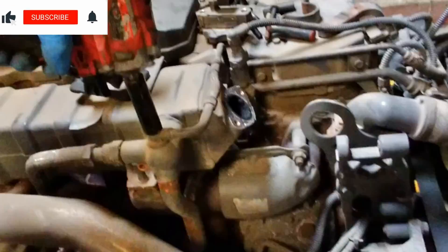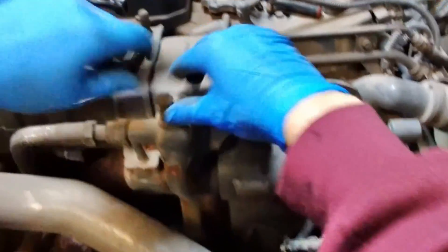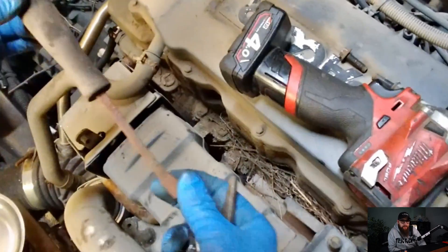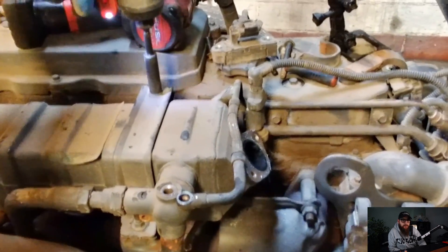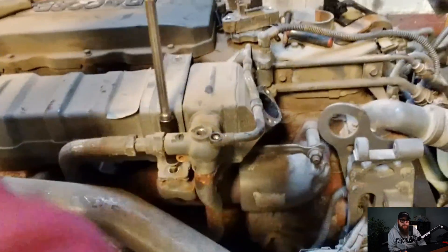I have a few bolts going on here, so I'm going to get organised. Looks like someone has lost a pry bar here once upon a time. While I'm pulling this to bits, I'll explain how this situation can actually arise. Excess soot can clog the EGR system, contaminating it to the point that it cannot operate properly. This is often caused by exhaust gas flowing back into the EGR loop, which clogs up important points in the EGR system. Depending on where the constraints are in the EGR loop, first the EGR cooler becomes blocked, causing the EGR flow to diminish, and the EGR flow value will be lower than expected.